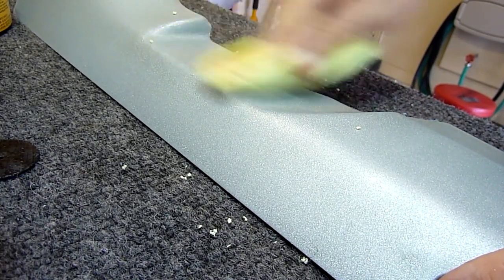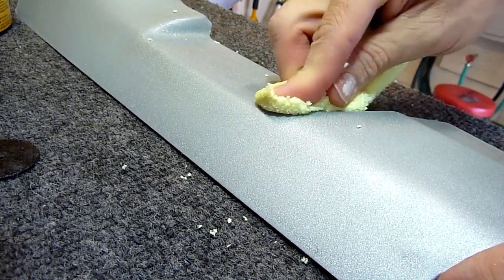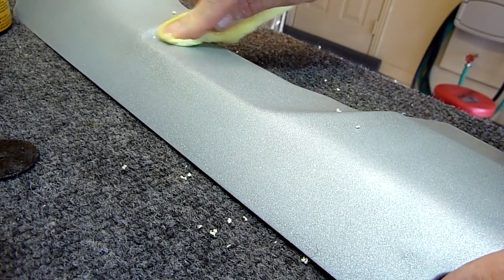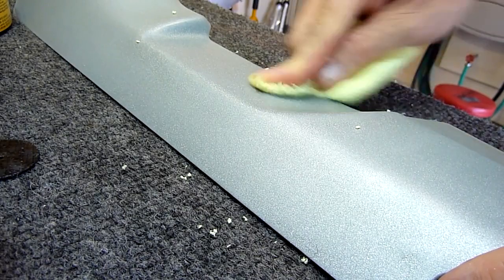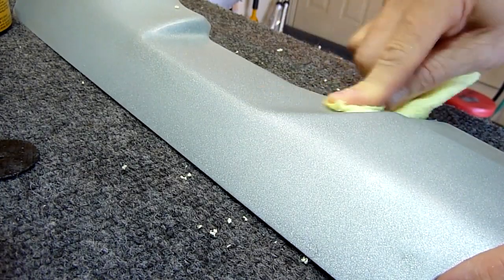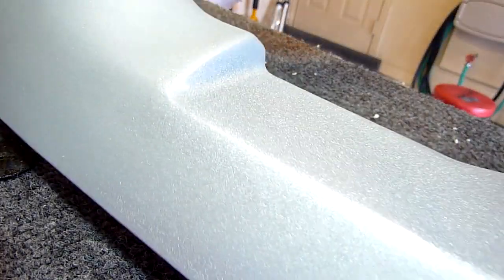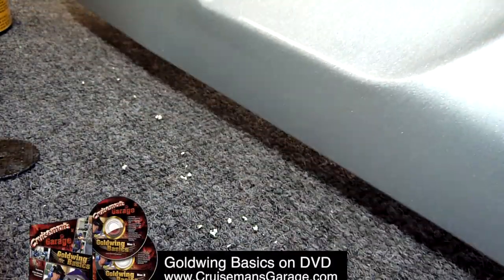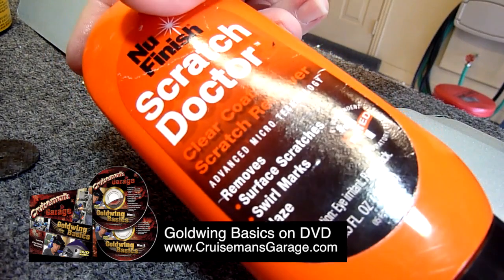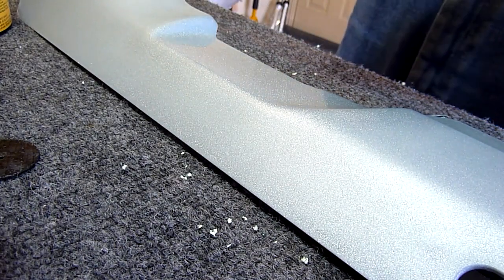So I'm going to really rub this in — I'm actually applying a fair amount of pressure. I don't have a hand buffing wheel or anything; I'm doing this by hand. The pieces are so small and there are so many contours, like you see in this corner here, that you really have to get your hands in there and do it. It looks pretty darn good after applying the polishing compound and buffing it out. My last step is I use a little bit of Scratch Doctor on there because it's an even finer cut than the polishing compound — it's for real light surface scratches.